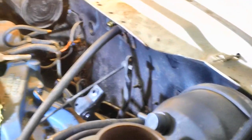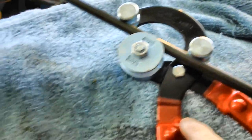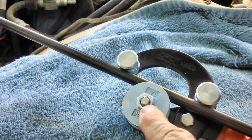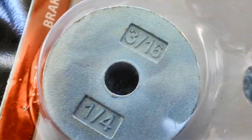Let me show you what we're going to bend this thing with — tube bender pliers. They come with two round changeable wheels. This is a 1/2-inch nut and you can bend 3/8-inch tube and 5/16. The other wheel they give you is for 3/16 and 1/4. Depending on the size of the tube you're bending, each of those are different sizes. We're going to be doing 3/8.